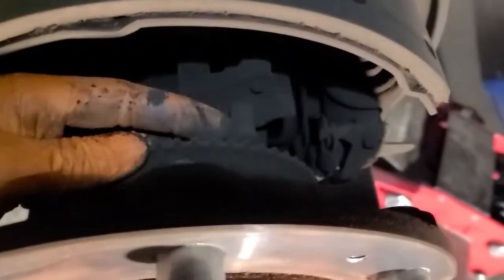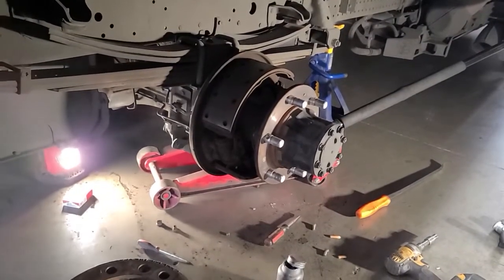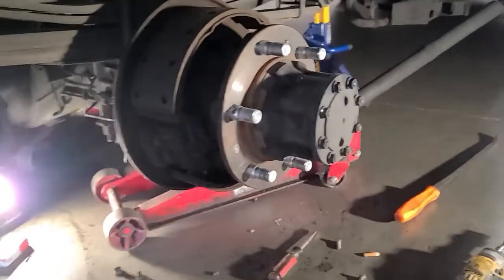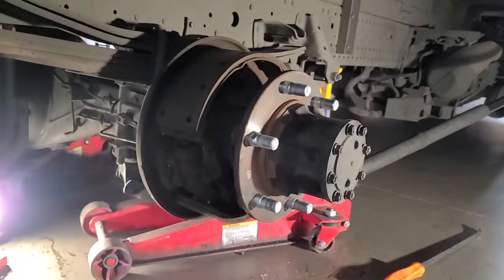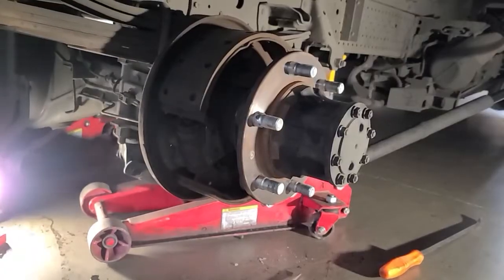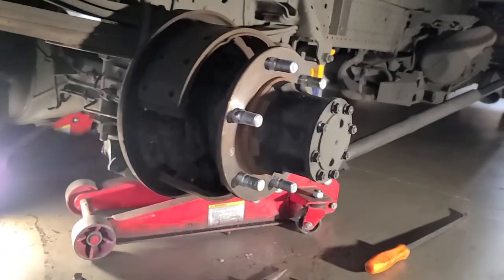I try to clean up all this. Your wheel speed sensor and stuff is right there — try to get all this cleaned up, this little ring and everything here, just clean the hell out of it. Prevent yourself some sensor issues and problems later. There's a little better video — better description. You got to see the whole process of removing that, and that's the hardest part. When you put it back together, always bring those brake adjusters to just before snug — where the wheel still freely spins, but not quite where it locks up or really slows down. Just as minimal play as you can get is going to be the best you can do with these brakes.